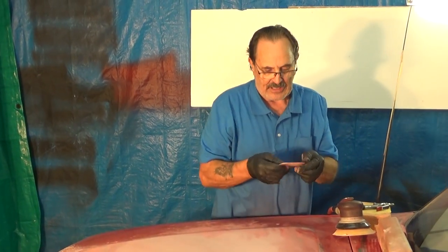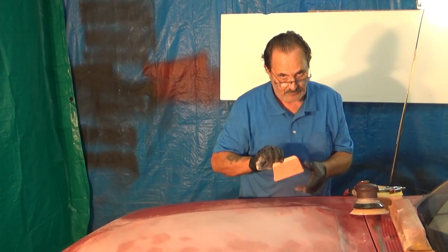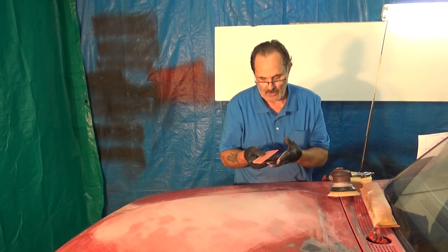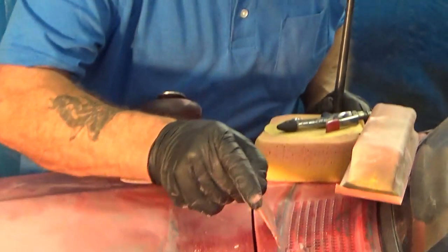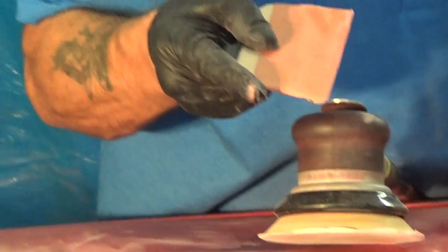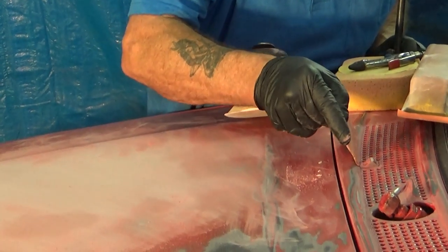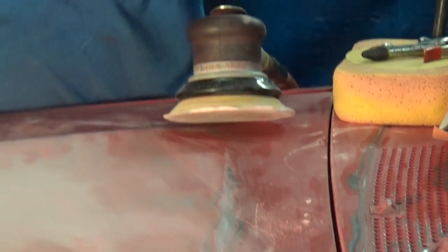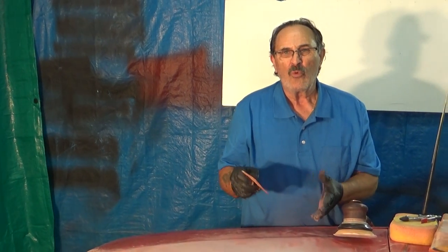One other little trick I showed in the first video: you can take this little spatula used for applying putty filler, and I've put a piece of adhesive 320 grit on there. There are a couple of little spots — right around here where the window water sprayer comes out, I left it on there — and you've got a little groove between it and the metal that you can't get in there with your fingernail or anything. You can with this — and there, I've got it. Just a little bit, that's all it took. This is plastic — it won't damage your body or what you've been doing.